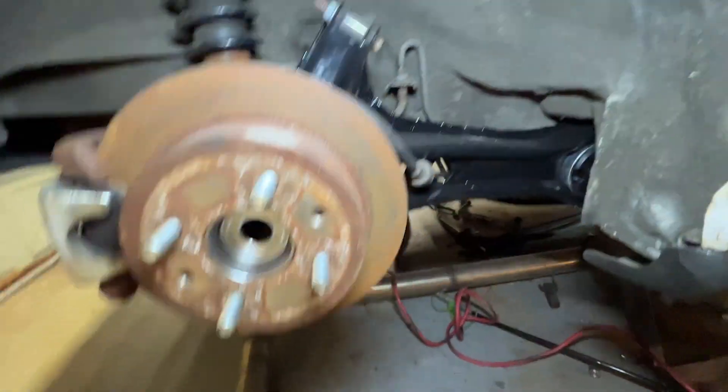The DIY diff mount that I was going to do — I realized the T-bracket doesn't fit and I need to modify the subframe. A lot of people just bash the subframe out, but I wanted to cut it and plate it back in to make a notch, making it much easier to take the transmission out. I also cut a small section off the subframe to make it easier when the transmission goes up and down. I can show you that right now.